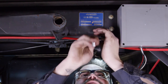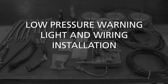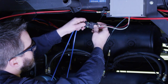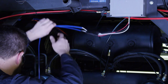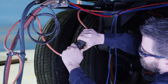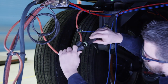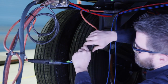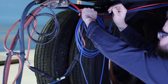Low Pressure Warning Light and Wiring Installation. Begin by connecting the control box wiring terminal to the terminal on the wire from your Tire Pilot Plus kit. Next, locate and disconnect the ABS power cable leading to your trailer suspension, then install the Tire Pilot Plus ABS power adapter as shown. You may wish to coil and zip tie any extra wiring at this time as well.